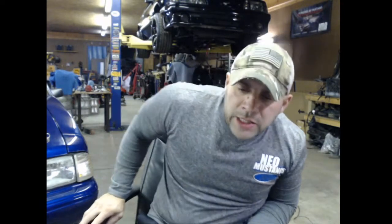I have an F cam and a 2 in my booth. That's right. Okay, LHS Hunter, head studs are not absolutely necessary, but for boost, I can tell you it does help keep you from blowing a head gasket, just the sheer mechanics of it.